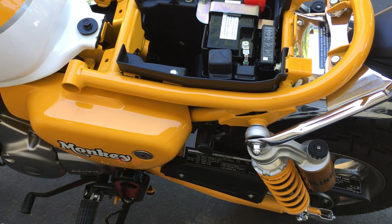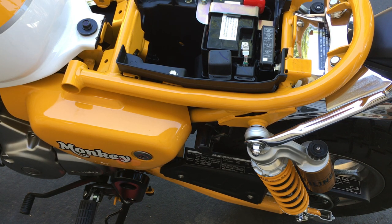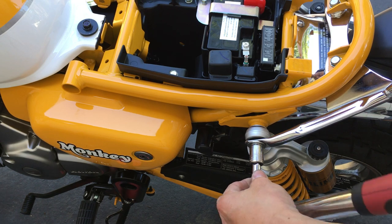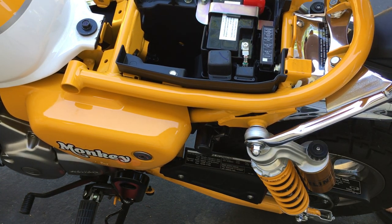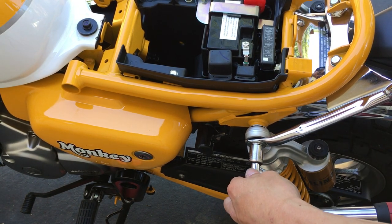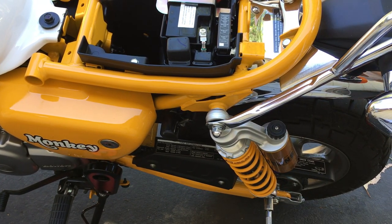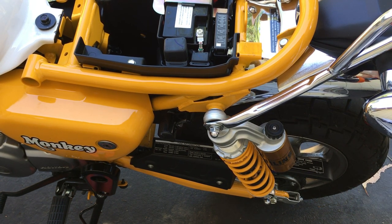Where is my socket? I heard it drop a minute ago. That was a small little socket that dropped. Okay, here - just 14 millimeters. Turn the thing back on, 21 foot-pounds. I'm going to do the bottom two, just because when I did these shocks originally I didn't know what the torque spec was and I didn't have the service manual. Okay so everything's good.